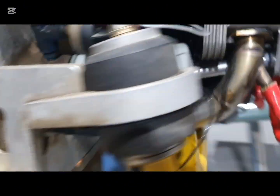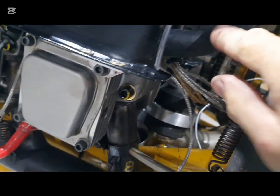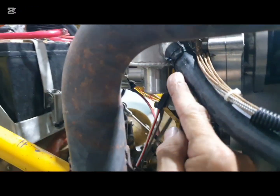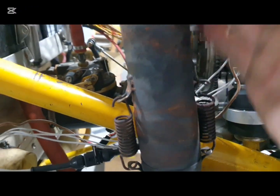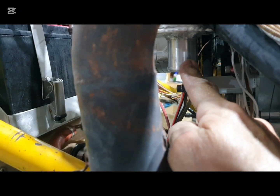All the plumbing is done in here — you can't see it but all the fittings are done. All these daisy-chained LCH fittings come out here to the header tank, and on the other side all the hot water coming out behind this shroud, out this pipe, then at an oblique angle going into the header tank to give plenty of clearance from the exhaust. And there's a bigger 32mm radiator hose to accommodate the increased water flow for two pumps.